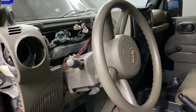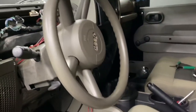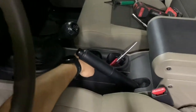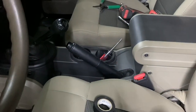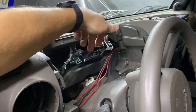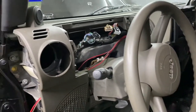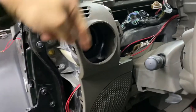Don't freak out — there are definitely easier options to route your wires, but I really wanted mine to follow the factory harness for the Jeep. What I did — and this is really easy, it looks much worse than it is — there are a million of these little seven-millimeter screws, so I just started pulling screws and all of this came apart very easily. This goes to the speedometer right here; there are three pins and you can't mix them up because they only go where they can go. Don't be afraid to dig in here and start pulling panels out — it exposes the main wiring harness so you can just follow where the harness goes.